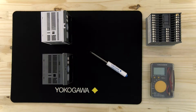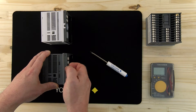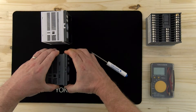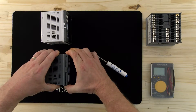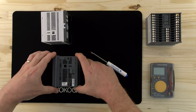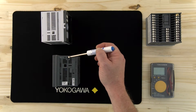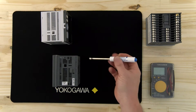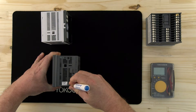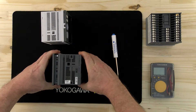To do this it's pretty simple — for this tab here you can just use your fingernail and pop it loose from the tab. Then take your hand on either side of the bezel and give the controller a slight pull on either side. Flip the controller over — we're going to be going down from the top now, directly behind the maintenance port. There are two tabs that we're going to need to release; that's where our screwdriver comes in handy. Push down on those, you'll hear a slight click, and then we should be able to remove the controller completely from the case.